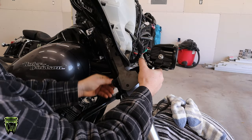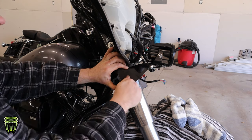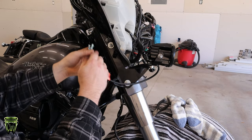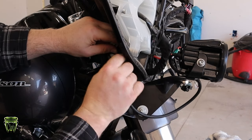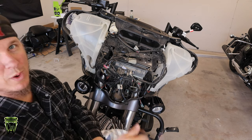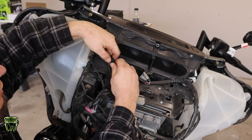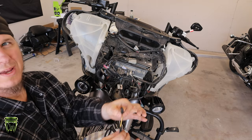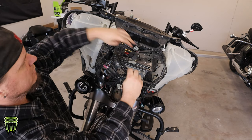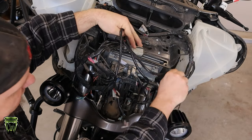Once you get them put together, you're going to put them on the bike with the two studs that you took off. Leave them a little loose to make it easier to put the fairing on later. Then run your wire underneath like this and thread it through this hole. Make sure both of those wires have enough play in them, and it's mounted. Once the actual lights are installed, it's time to wire them. Right up here next to your vent, you're going to have an accessory plug — it's a power plug with a little dummy in it. Pop the dummy out, and then the female side of your harness is going to plug in to that. This relay module and everything is going to sit up there, so you're going to want to route these wires down out of the way of everything else.